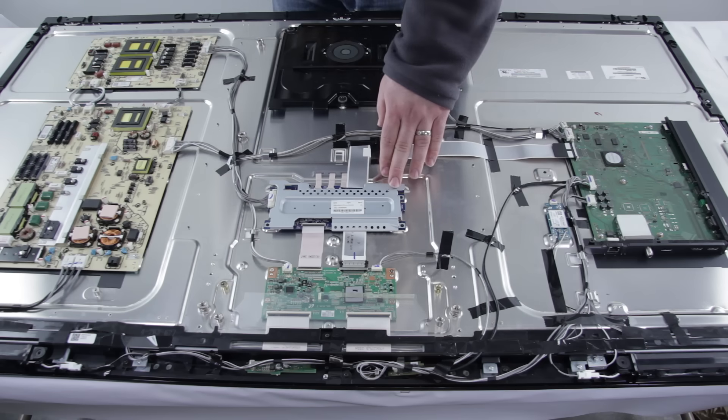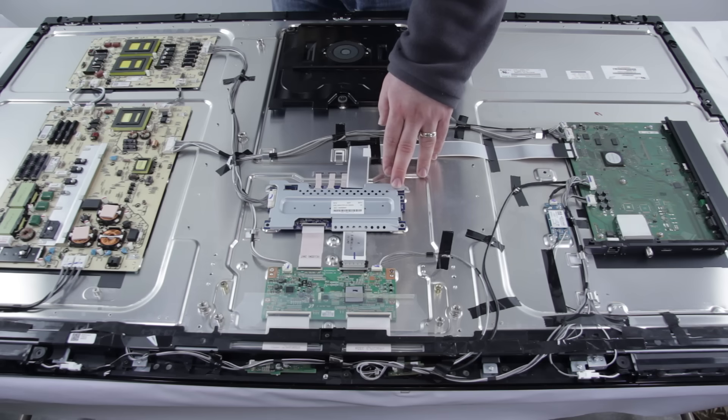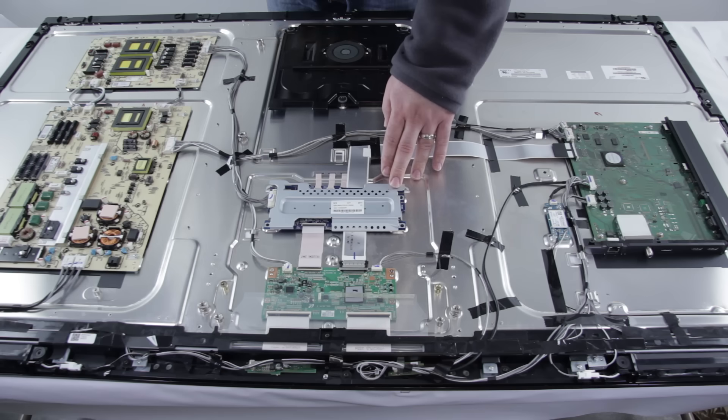The LED driver is similar to an LCD TV's backlight inverter. The most common problem here is that you wouldn't have lighting from the LED driver — your TV would turn on, you could have sound, but you would have no image on the screen and no backlights. You can use a flashlight and run the flashlight test on your TV. We will put up the link on the video for the flashlight test so you can learn how to determine with a flashlight if your TV has backlighting or not.